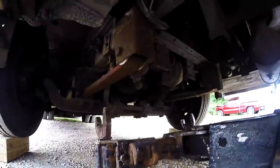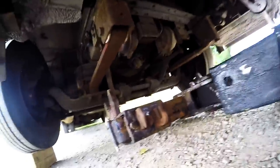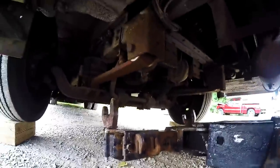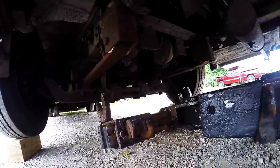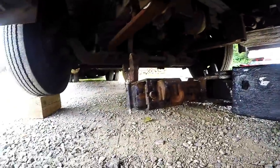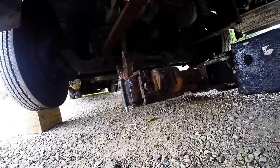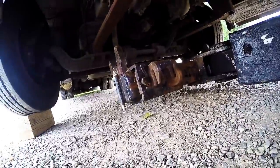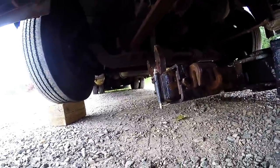Now this one, the wheels aren't so far back that I can't reach the axle — otherwise I'd probably go for the spring hangers. And it's not heavy enough that I need to go to the spring hangers. If it was heavier, there'd obviously be way more leverage on the back of my truck being pushed out this far. But I can go back and reach that axle just fine. The whole time you're underneath this thing, you want to keep it on the blocks — never lift it off the blocks while you're under here working.